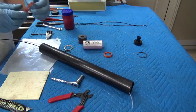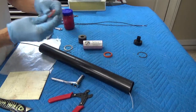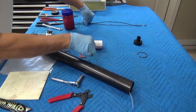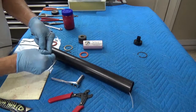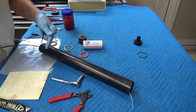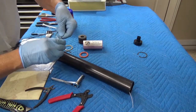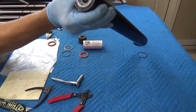Now we have our O-rings — a pair of square O-rings, a large and a small. One fits inside the other. And we have our igniter wires. The igniter wires basically fold over the copper. Make sure that it is not grounded — if it is, just cut off any excess so that you can fold over that wire. Once folded over, those get inserted into the igniter cup.